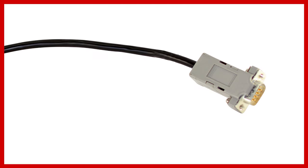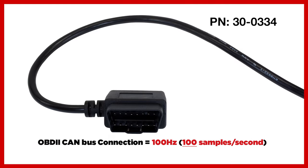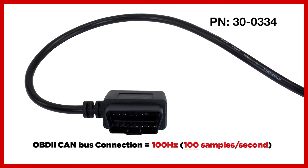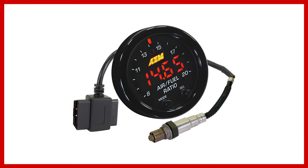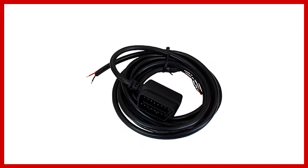For those who don't have a full standalone engine management system and are tuning on an open source platform — previously many of those platforms took in data via serial, which is capped at around 10 hertz. For the X-Series wideband, we've added a new part number, the 30-0334. This integrates via OBD2 for 2008 and newer vehicles, so you can get the AFR data to your HP Tuners or EFI Live software with a simple OBD2 passthrough connection.